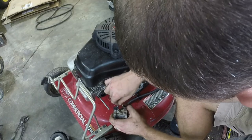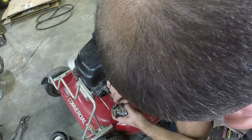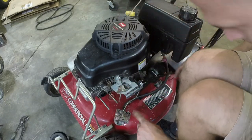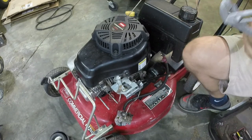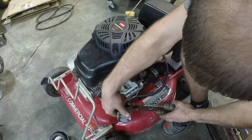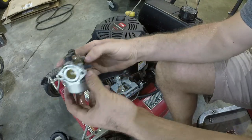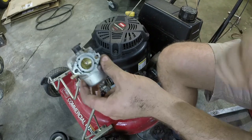So the choke — we're going to get that off. The choke and the throttle both have springs. The throttle spring, we'll get that off as well. Get the fuel line off. The guy who had this kept it up in really good condition — I know he used it commercially but he kept it up really good. We're going to get this on the carb stand. I think we just need to give it a quick spritz with some carb spray and that will probably get us back operational again on the running side.